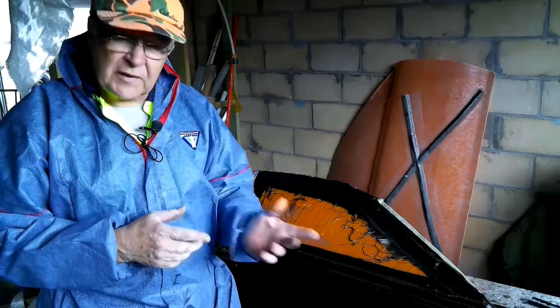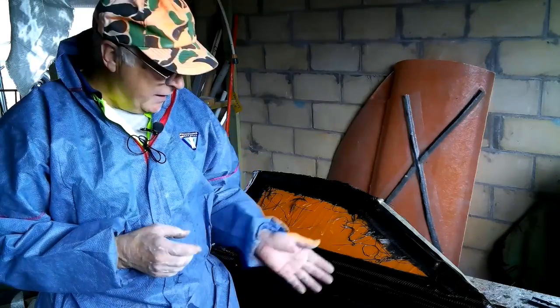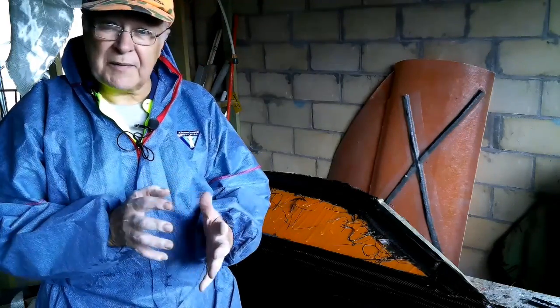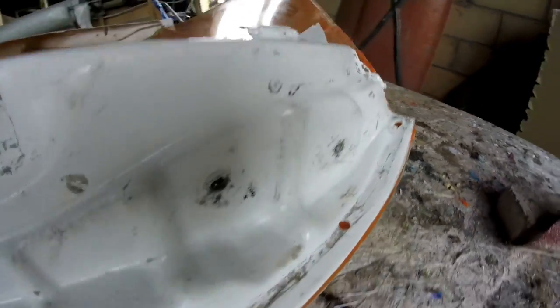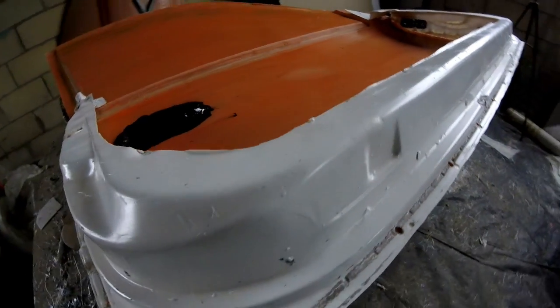Joining these two halves of the door together before this carbon fiber is out of the mold, let alone even fully set, ensures that the two halves will come together and retain the shape of the door without the twisting that is so often involved in a job like this. I've drilled holes all the way around the inner door skin so the resin will spill out a little bit and lock things together just like spot welds.